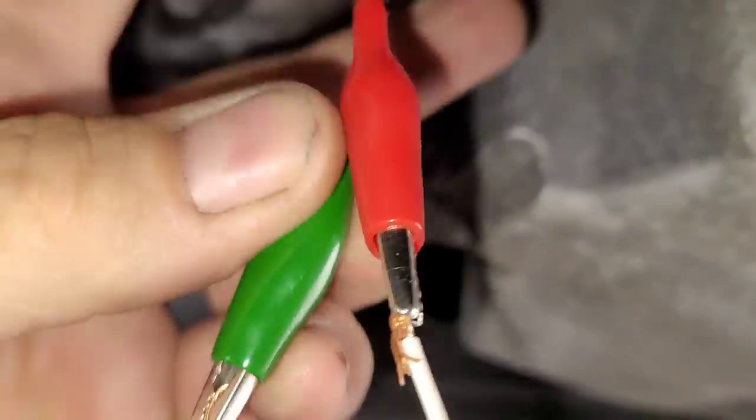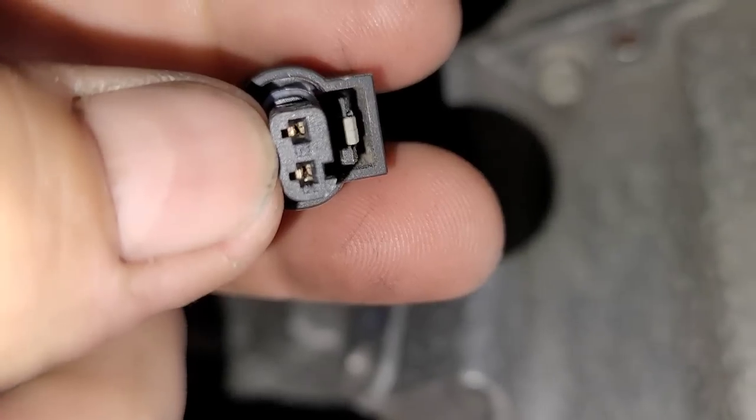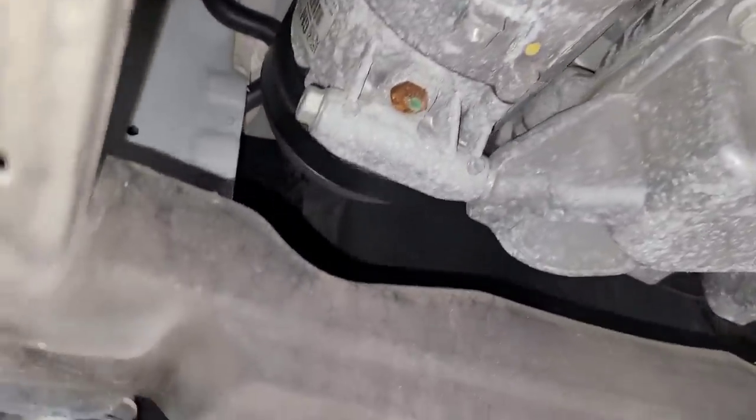The reason for the light bulb here is I wanted to check the circuitry itself. I'm actually going in at the top edge, to the outside — that's kind of like the spot where you would use to pull a pin out if you had to. So there's the compressor itself. It's getting power, it's getting ground — enough to light this bulb, which tells you it can handle amperage. The clutch isn't doing anything; it never turns on. So we're going to be putting a compressor in.